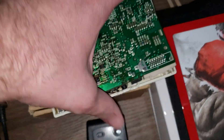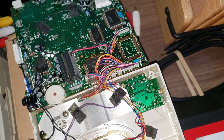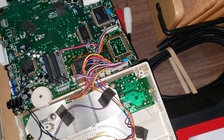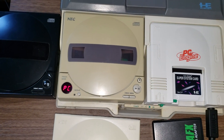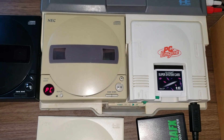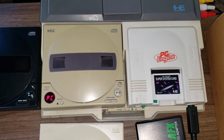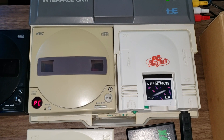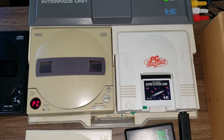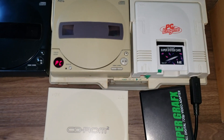I found a better place to do this. Pulled it off right there because it has a built-in ROM on that microprocessor, and the ROM version was slightly different for this drive. The 35D was meant for SCSI — it came with a dock that adapted it as a SCSI drive for old Macs and PCs in the late 80s. Old 1x CD-ROMs were trying to get the most out of this design, make it work with as many things as possible.